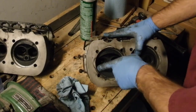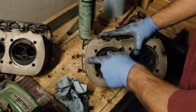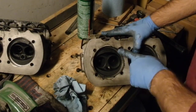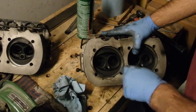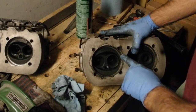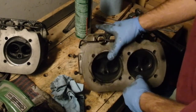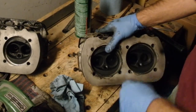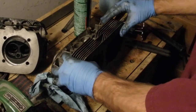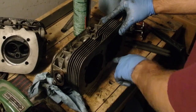I'm thinking it possibly down in here does not have a tight seal, so some of the combustion gas can blow that way. Over here I think that's just a bit of oil. But you can see there's a lot of buildup — pretty thick buildup around this one more than any other. And I did have one cylinder that had particularly low compression. I don't know whether it was this one or the other one, but I do know it was number three, which would have been in this position if this was the driver's side head.